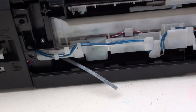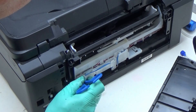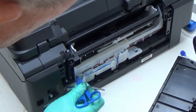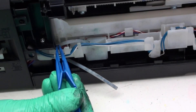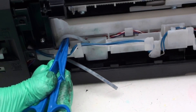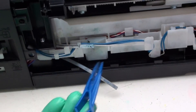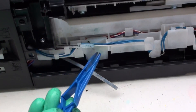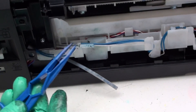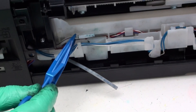The other waste tube — we do the same thing. Use your tweezers or forceps or whatever you've got available to just gently hook that out and pull. This is connected at this side but it's loose here, so you're just gently lifting that out. Now as you saw, it flicked — and if it had ink droplets in it, that would have flicked up in my face. So just watch out for that, take your time; tweezers is a good thing.